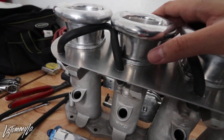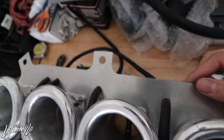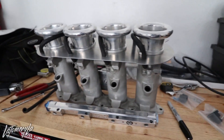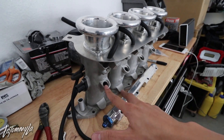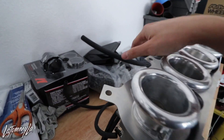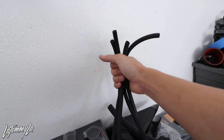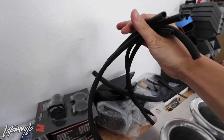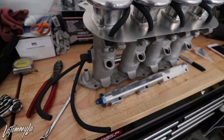So I routed the vacuum lines through the base plate, drilled eight holes, and it goes all the way through. I took out the fuel rail because I'm gonna be putting my injectors on when I put the ITBs on the car. These are all equal length — I cut them in half so it's four feet each, which'll be enough to reach the block on the firewall. I'm actually gonna be reusing my RDX 410 injectors — my tuner said just keep them. If anyone wants the RC 440s I'll post them for sale on my Instagram.